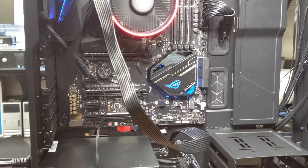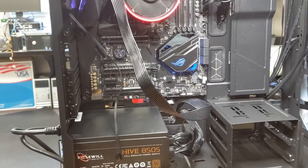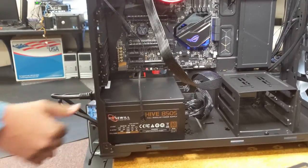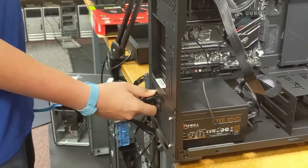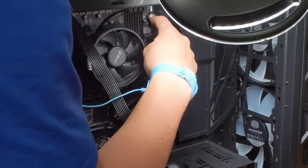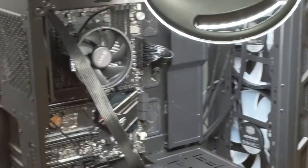Now it's time for the RAM and the video card — turn it back off. To turn it off, just turn the switch off from the power supply. Then unplug — it's not really harmful since we don't have an operating system. Unplug the power supply itself and discharge by holding the start button. Everything is now discharged and we can start adding our RAM, graphics card, and everything else.